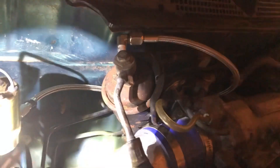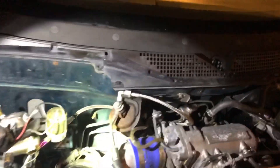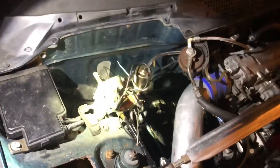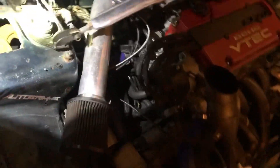For the fuel tap, I'm going to be tapping into the fuel filter at the top — there is a banjo bolt, and there's a company that makes a fuel pressure gauge fitting. I found it online, I believe on Amazon or eBay, that had just the banjo bolt with the fitting. I ordered that for $10, and once that comes in we'll be ready to go with the nitrous. I also found out that the purge solenoid leaks a little bit — hopefully I can power it up, click it on and off a few times, and free it up. Even if it does leak, I'll probably still run it temporarily.